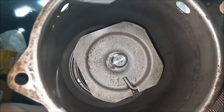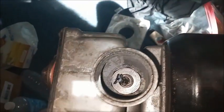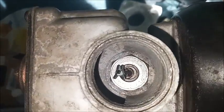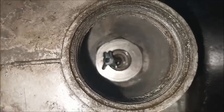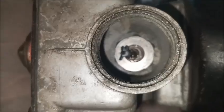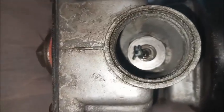And there it is, and when I released, it pulled the plunger out to its normal release position, and I pulled the cover off to see that the compensating valve is held open as it should be. Pressing in on the plunger and letting go.